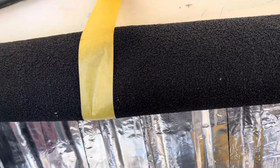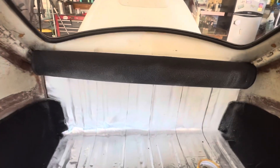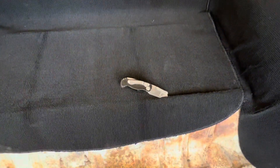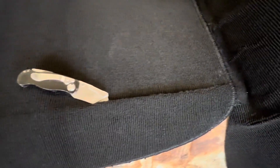I've rolled up the carpet so I can get glue on that back part, then I can let it fall and it'll do what it needs to do. As I unroll it softly I could be adding more glue to the backing of the carpet, but can't do that one-handed. Now I'm just going to trim this edge all the way across with my razor blade — it'll tuck underneath and we'll glue it down.